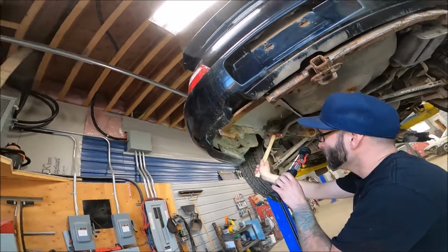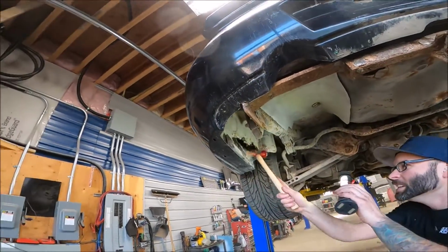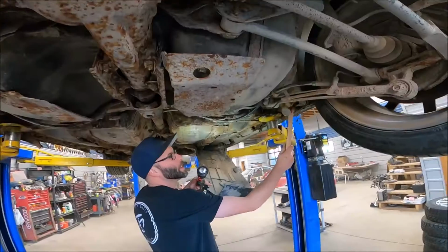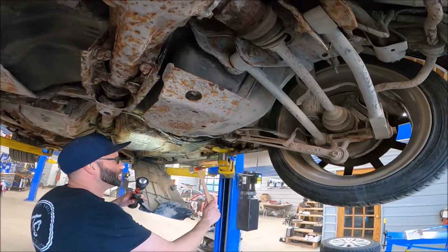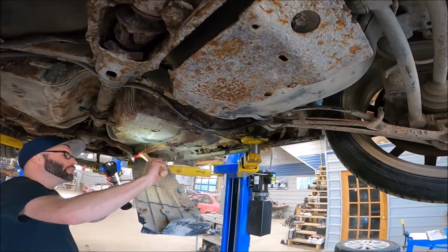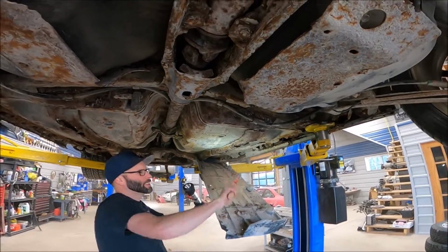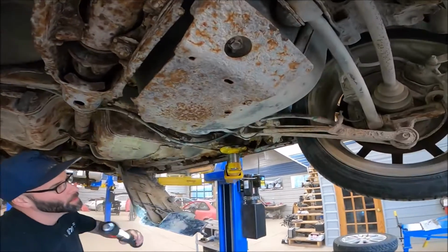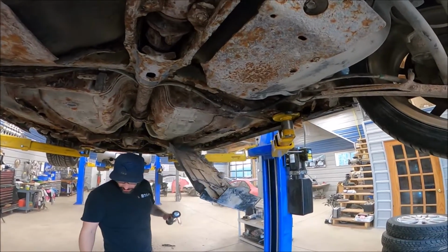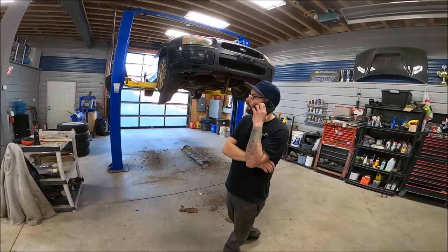But then down in the bottom of the rear quarter, toast, just toast. This is another route you can get your jack out from. Inner rockers, totally done. You'd be going forever just to find somewhere to actually weld to. It would need a whole new floor. It's completely not worth it. I just wouldn't do this. It is just wild. We're gonna call the dude Dave Harvester.